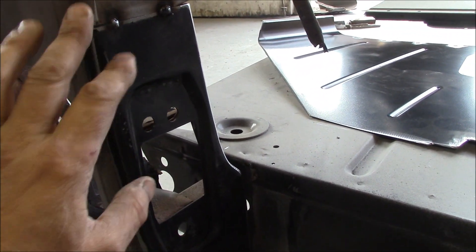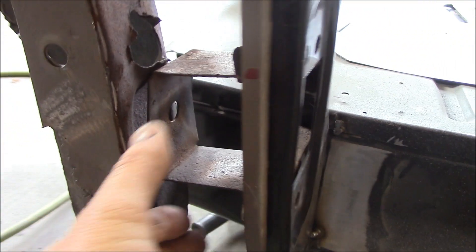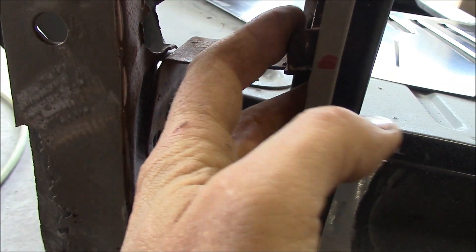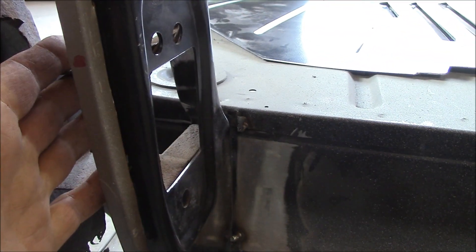What I've done is I've cut this out and I'm butt welding it in. But before you can do that, there's a little pocket thing right here — it spot welds in behind there and the hinge rests in there. So when you cut this piece off, you get the piece off and you put that pocket piece on first.